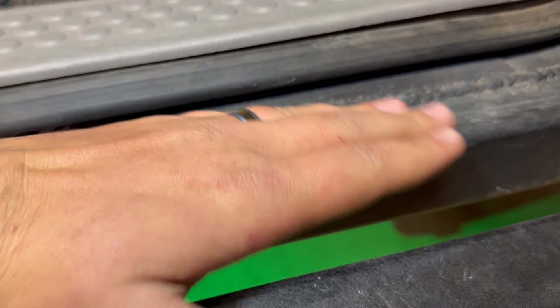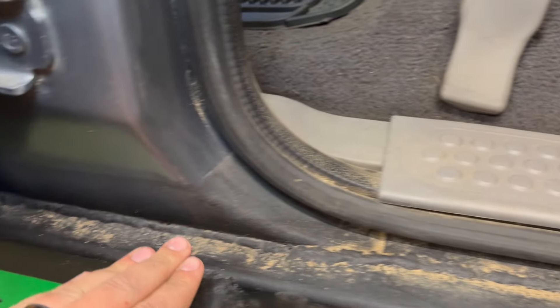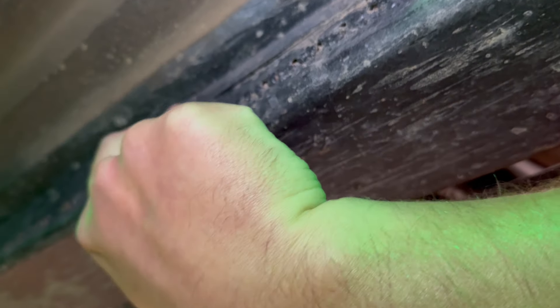Inside, the actual rock slider construction: we cut it right where it's flat. This comes out to right where the weld is and goes down to the original box. You're seeing the cut completely across, and then we laid that 2x4 in there. So you cut the bottom of the pillars — all three of them on the Excursion — and tried to be pretty flush with this. You pulled these seals out and you've got plenty of room in there to weld and set that up. On the back side, I left some of the lip here, so this is factory sheet metal right here, and then welded to the bottom of it along there.